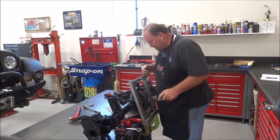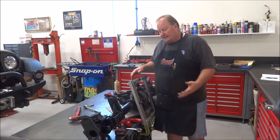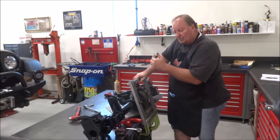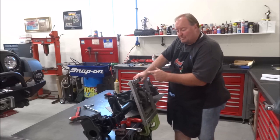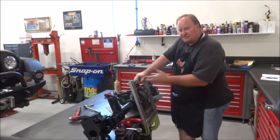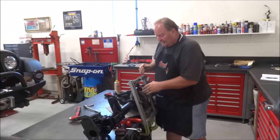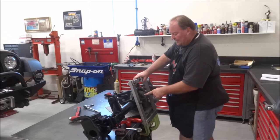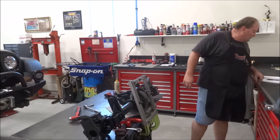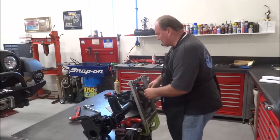Okay, take two. So I ended up removing 10 thousandths from under the pinion. It was off quite a bit, so I like to make big changes at first, and then if I go to the other extreme, then I know I'm somewhere in the middle. A big change is 10, 12 thousandths, somewhere in there. Small changes, I'll go 3 to 5 thousandths. And because I moved the pinion closer, I moved the carrier away, and basically I just switched the sides. So I'm running 131 on the left, about 141 on the other.